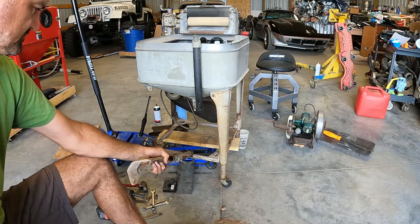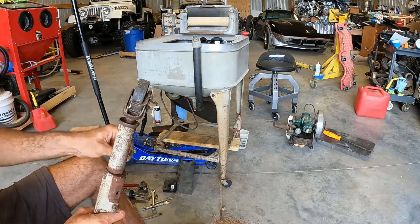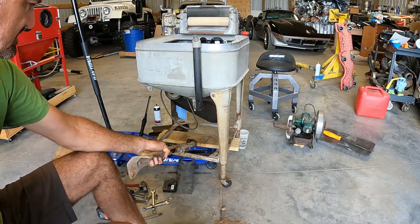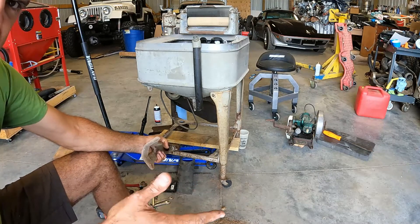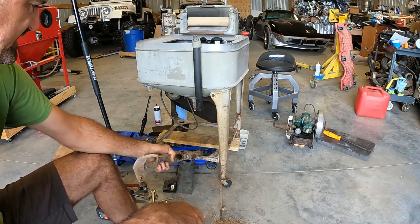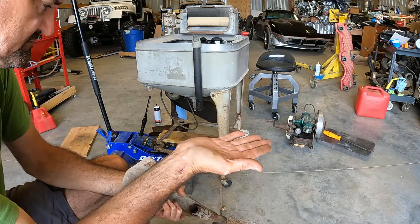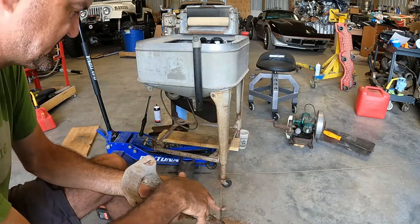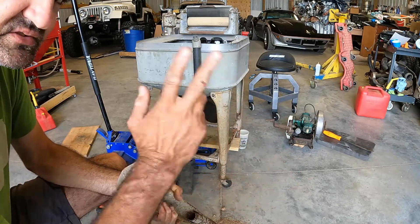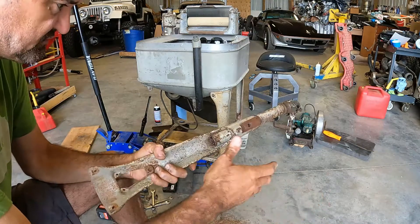This tray where the electric motor mounts — from what I can tell looking on other YouTube videos — the gas motor trays are different. I think they sink down in the middle or mount differently so the engine hangs lower than the electric motor does. So I tried every way I could think of to mount the tray either on steel below, hanging up from the bottom of that tray, or sitting on top of the tray. In order to have room for the kickstart and to have the belt — there's some leeway there, about an inch either way — it just won't fit.